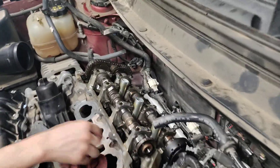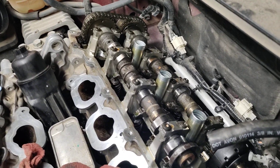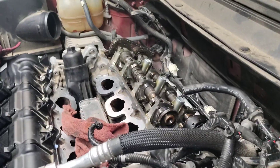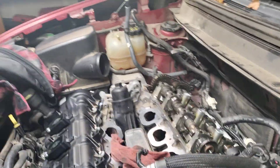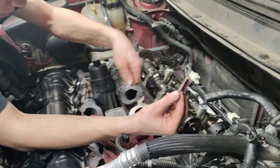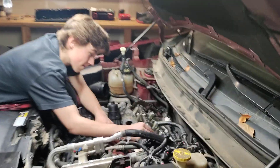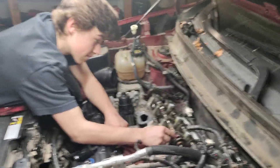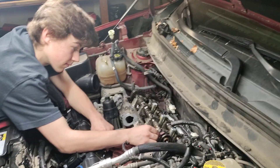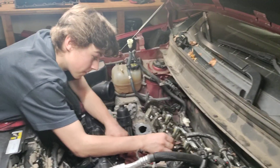There's some information on the Jeep Cherokee with the 3.2 liter V6 engine — PCV valve and system can get clogged up, causing moisture buildup in the engine, causing what looks like a blown head gasket and coolant-oil mixture, but it's actually just moisture buildup and oil mixture. If you find sediment and buildup on the cam lobes, you can get away with just polishing them very carefully and meticulously. Thanks for hanging out with us. If you have any questions about your project, shoot them in the comments. If you're just now joining the community, don't forget to hit the like and subscribe button. This is Matthew, your friendly neighborhood technician and Braxton, signing off.